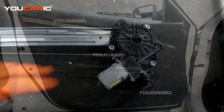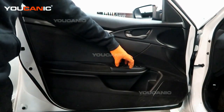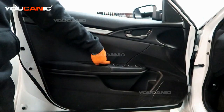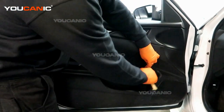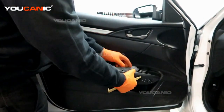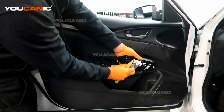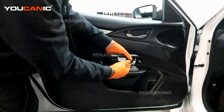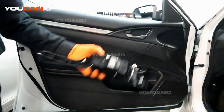Start by popping up this little controller and pulling this little piece, which holds your window and door switches. Under the electric here, there's one screw down here to begin. So we work that up and out. There are little connectors here with a tab you have to press in. You'll be able to get the electric connectors undone, and we've got that connection undone. Now we have that out of the way.